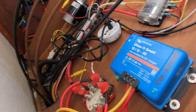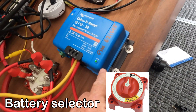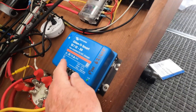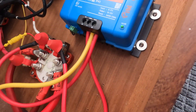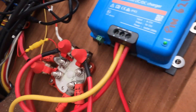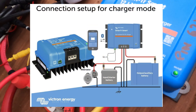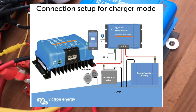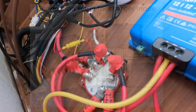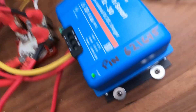When you look at the installation of the unit itself, you can see it's really simple. You get an on/off light and a Bluetooth light. On this unit you have a line coming in connected to the starter bank going to the input, a ground going down to the starter battery, and an output that connects over to your house bank.